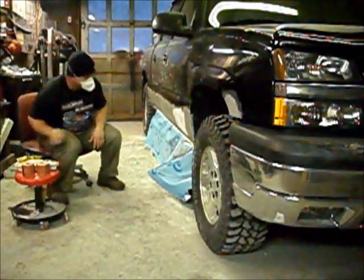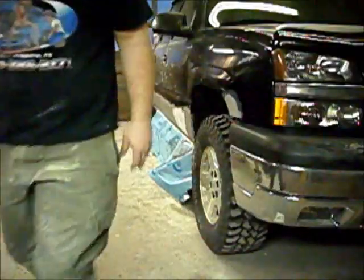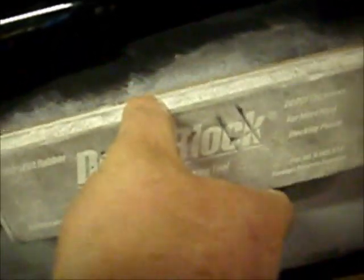Alright, found a little spot. I want to show you guys. Alright, see how this is all light gray? All light gray. And there's a little bit of orange peel right there, left. That's a little spot. And see how I'm using a long block that's a lot longer than that little spot? What that's going to do is take these and this, and make it all nice and uniform and straight, because instead of concentrating on just this little area, I'm going to sand the whole area, which is going to level this, this, and this all together as one.